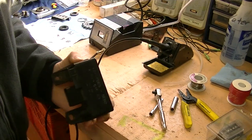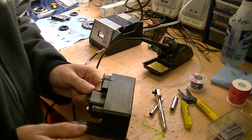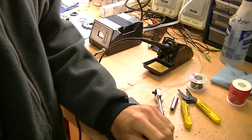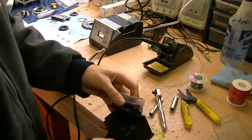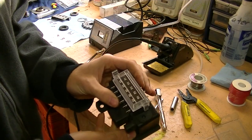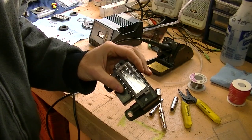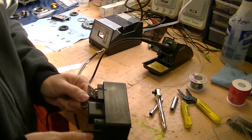Which I think is just stupid. So having hunted around the internet and read several fixes, what the Sprinter guys do is cut out the internal fuses and mount an external fuse block on top of the relay, moving the fuses to the outside so that you can easily change them and see when one's blown — also identifying which glow plug is bad. Which makes so much sense to me. So that's what we're going to be doing today.